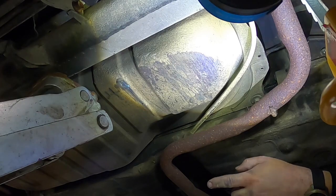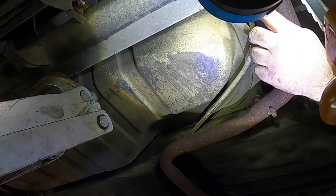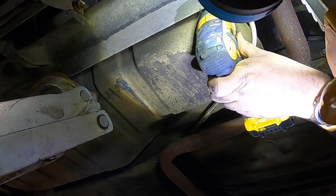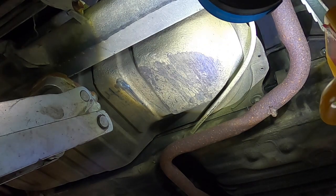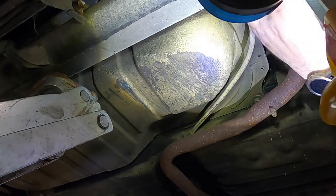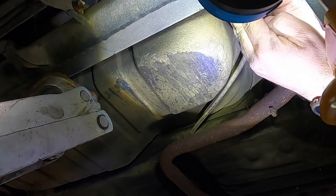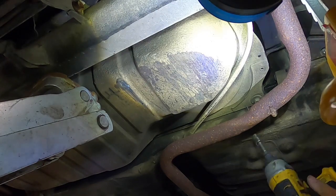The parking brake cable has a little bracket that attaches to the fuel tank, and of course it is a different size than all the bolts that hold the tank in. And now it's off — it's actually a nut. So that is off. What I usually do because I'll lose this nut is just stick it back on there so I don't lose it. Now the nice thing is I should be able to just zip these 12s off.